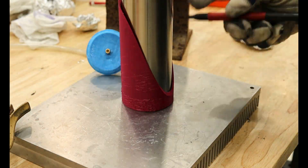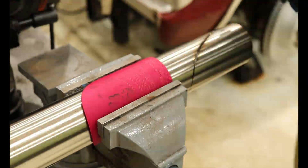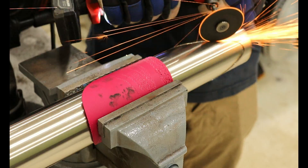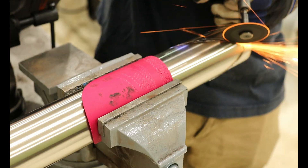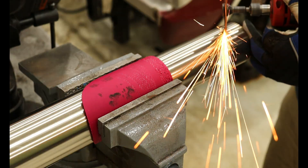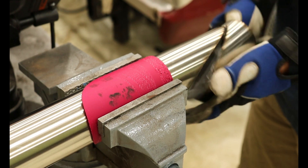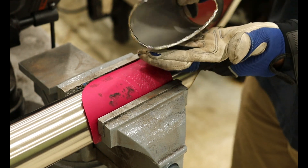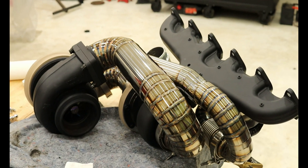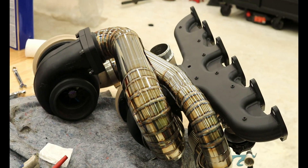The next step was to create the merge tube where the wastegate dumps into the hot pipe between the turbos. This is where I love having a 3D printer. I designed a jig in CAD so I can trace out the shape I need to cut out for the perfect merge. Off camera, I cleaned it up, figured out the small pie cuts I needed to connect everything, and tacked it up. This merge fit almost perfectly the first try. This compound kit honestly looks pretty cool on my bench upside down — you really get a good view of all the piping involved and routed.